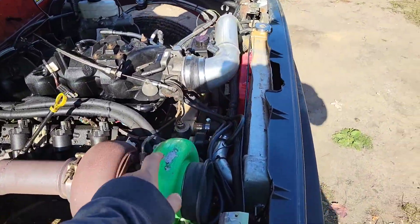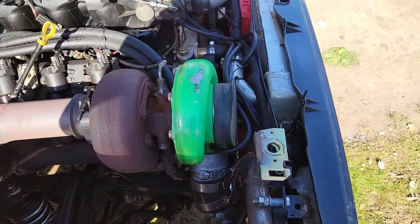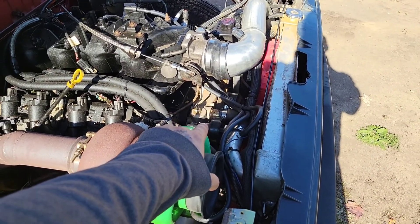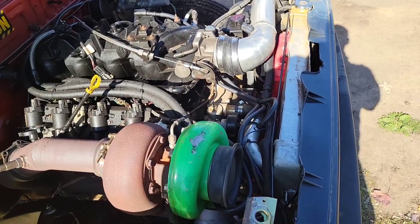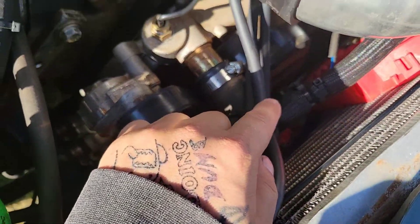This thing will see a new motor, a new driveshaft, and a couple other upgrades. New turbo - I'm going to a VS Racing 7875 with a billet wheel. I'm also going to an electric water pump. The reason for an electric water pump is that I can run it while the motor is off, meaning I can cool the motor down while it's sitting.